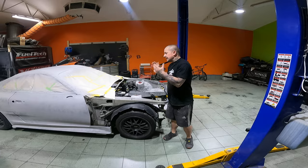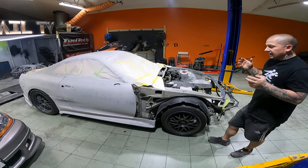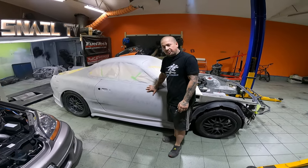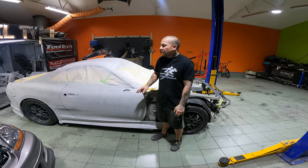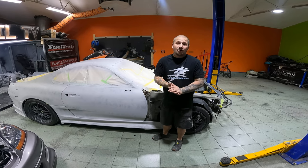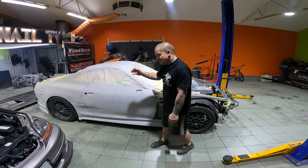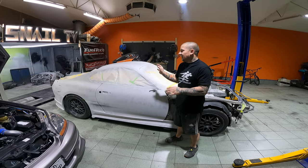First on the agenda is a Toyota Supra — this is Omid's car. He's a great customer of mine and we are doing a full body respray on it. Unfortunately this car had a spray wrap on it, so it's taken about three to four weeks to get it removed. It's been taken down to bare metal and gone through about four litres of paint stripper. It's been high-fill primed and is ready to go on all the bodywork. The body kit and everything was in really terrible condition, but we're smashing through it.